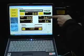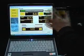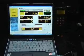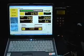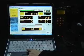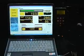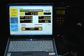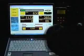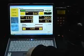We can ignore these two figures. You've also got fuel trim here so you can see which way the tuning needs to go. To make the first change, we take the car to approximately 2,000 RPM, press the space bar, which now goes to gas. We're on gas now. We have a quick look at the pressure as we decrease the RPM down to idle. There's 1100, more or less ideal. Injected duration's 3.7. We don't leave it on gas for very long. We go back to petrol.